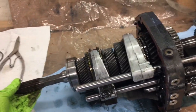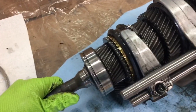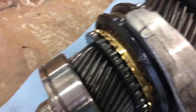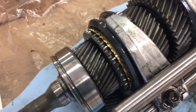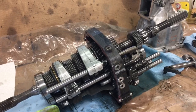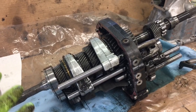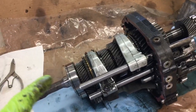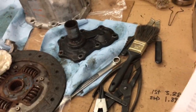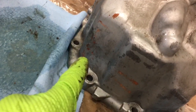For anyone interested in what it takes to remove each side of the case, hopefully this video helps a bit. I'm going to clean everything, get the sludge out, get those metal shavings out, and put it back together. The synchros, from what I can see, are in really nice shape — which also leads me to believe this transmission has been rebuilt. My guess is it's a W55 housing with W58 gears. If anyone has access to searching serial numbers for Toyota transmissions, here is the serial number off this case.